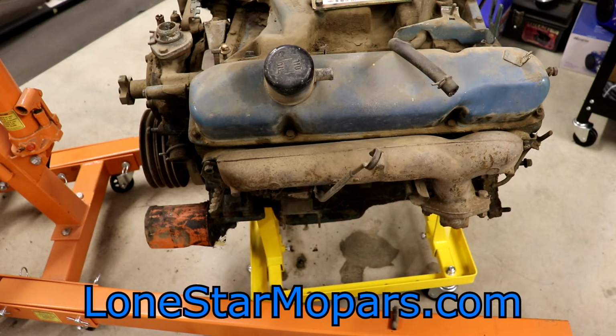But you could easily adapt this to your own casters if you're going to always do a 440, or if you stylize this for a 350 small block, or if you're a Ford guy and you want it for 429s. Once you know where everything's going to line up, and you always have your formula for oil pans, you're not going to have a weird kick out for road racing or something. You could easily come in, grind this all down, weld it in place, and use this as your footprint for your custom stands, if you will.